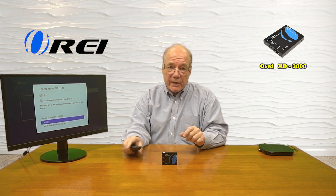It'll take a second. Now the Roku is a smart device — when you first connect the display it's going to make an adjustment to the resolution to show you a picture. But I've gone into the display settings on the Roku to force this as a 4K 60Hz monitor, which forces it to output 4K content. You can see that it won't display 4K and it's not HDCP 2.2 compliant. Now the XD3000 is going to do two things: it's going to convert the 4K content to 1080p, and it's also going to enable HDCP copy protection.